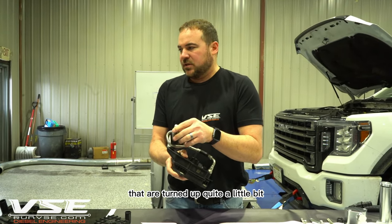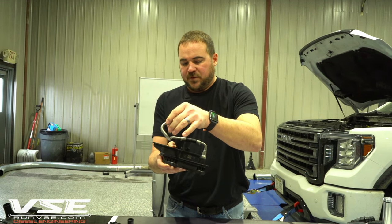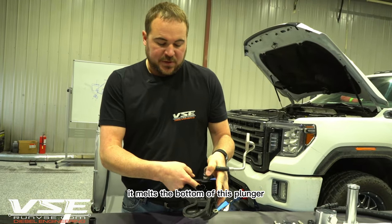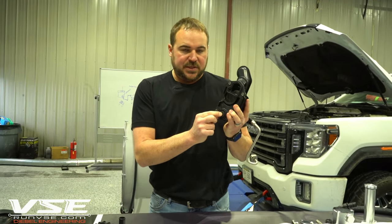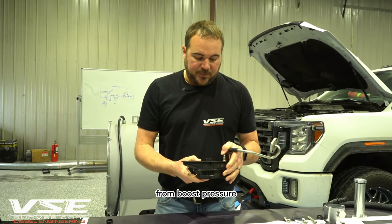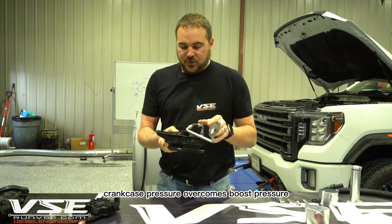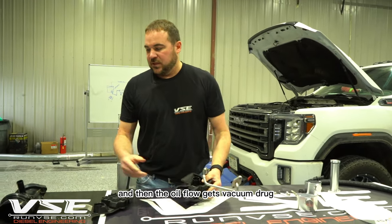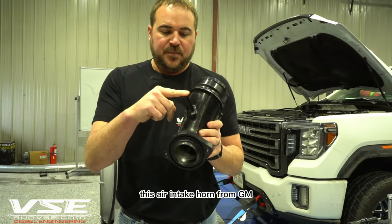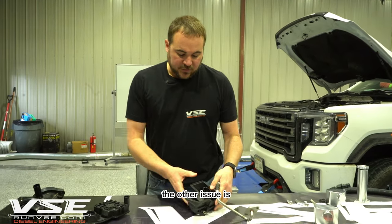The problem is you can sometimes see 400-degree charge air temperature at the outlet of the boost pipe, especially on trucks that are turned up. We've seen this melt the bottom of the plunger and then the bottom of the housing, putting full boost pressure right into the crankcase. We've seen motors run away from boost pressure being induced into the crankcase, and when the user lets off the gas, crankcase pressure overcomes boost pressure and oil gets vacuum-drawn right into the air intake horn.